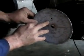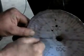I marked it to 28 degrees, which for this piston is the full advance mark. It also has top dead center. In these two little holes here, I just stuck a little paint pen and made these two marks. So this is now full idle. The way it works is when I hit full advance, using the strobe light, these two will light up.